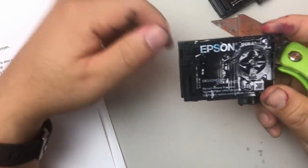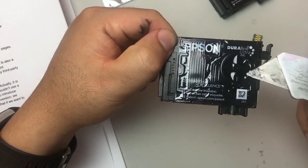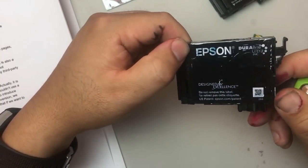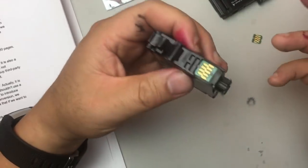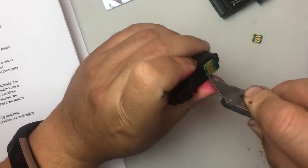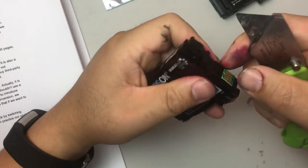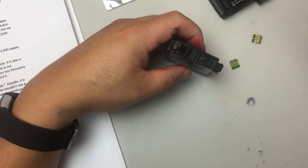I really like that Epson has a one-way damper that nobody else manufactures. So if you prefer to use a real Epson cartridge, you can just take the chip out — get a razor blade and dig in. There's no glue or anything; it's just a cap.